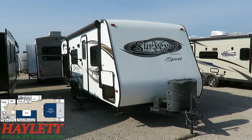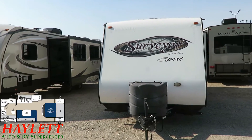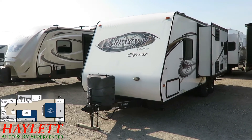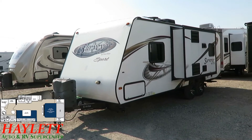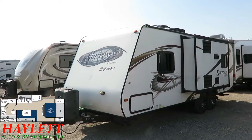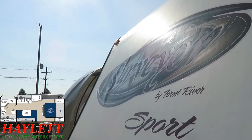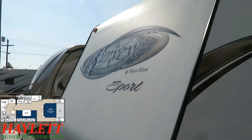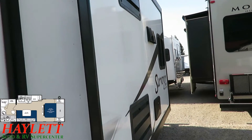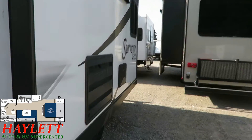These are all aluminum structured and actually six-sided laminated — laminated front and rear walls, slide-outs, floors, roof, and side walls. The side walls still have a really nice amount of gleam. The solar delamination up front might make you think you'd see decal failure and degradation, but that's actually not the case. What that indicates to me is that although this thing was stored in the sun, it was also impeccably well kept and maintained — not just left to rot. The shine and gleam on the sidewall makes it very obvious this was kept clean and UV protected.